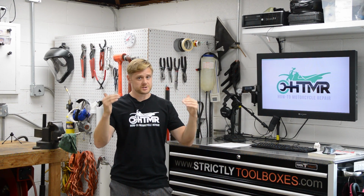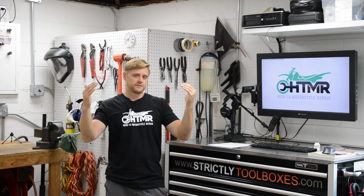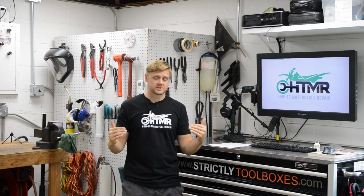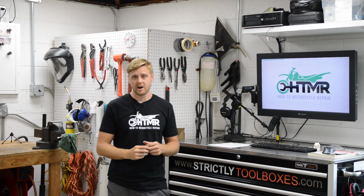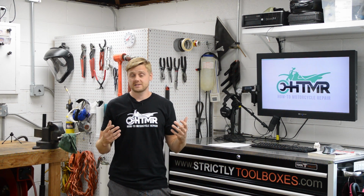Now, like I said, normally you do a compression test, and if the compression test numbers are in spec, then no need to do a leak down. If the compression test is low on a certain cylinder, that just tells you you have a low number, and you have to do a leak down test anyway to pinpoint the problem. Okay, so we'll just jump right into a leak down test and see where we're at.